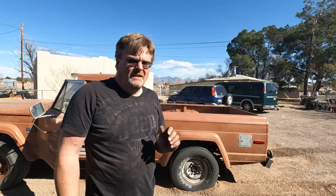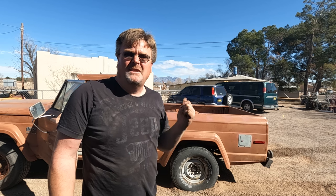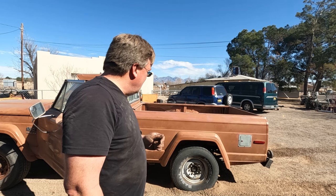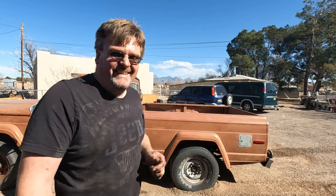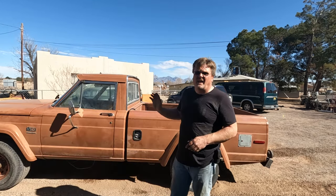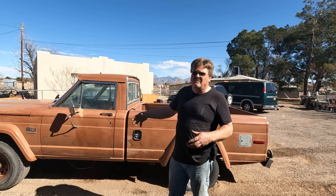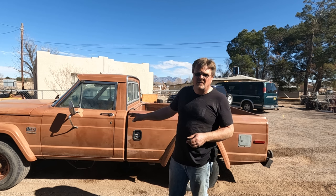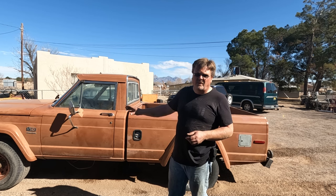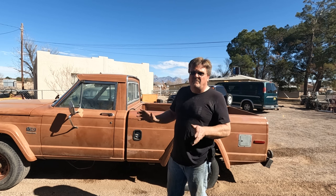There's a possibility I have too good of brakes — or at least too much sticking on in the front. I'm stuck on level ground because the front wheels don't turn anymore. Well, that's it for today. More work needs to be done — I've got to get the front brakes to release. I'm betting they're just full of crud and haven't moved forever. It might go away on its own, or it could be collapsed lines. I'm going to let it sit — if it depressurizes and then rolls, I'll know a little more about it.